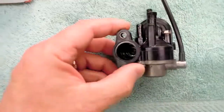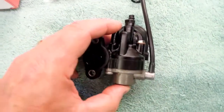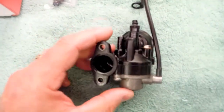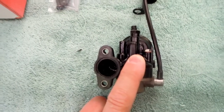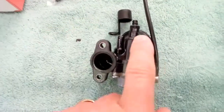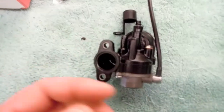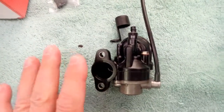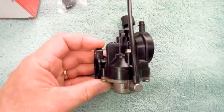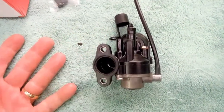This is the original pump — it was still pumping. I'm not replacing it because it failed to pump oil; I'm replacing it because it had been leaking for some time, and in fact it was getting worse. It was weeping oil all down into the lower part of the golf cart, into the belly pan — two-stroke oil was all over the place. It's been getting worse over the last couple of years, so I'm replacing it because it was leaking so badly and eventually it would probably have failed.